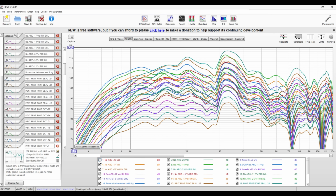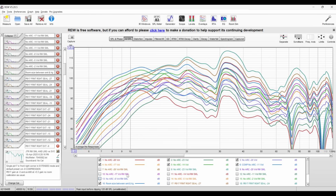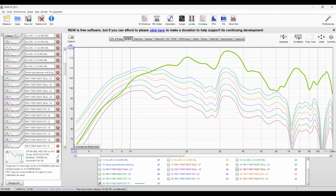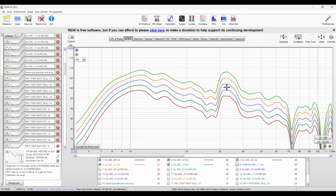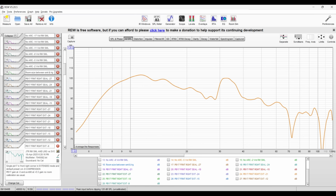Okay, so let's clear the room size set to small first for the JTR, and clear all these other measurements. Sorry guys, it looks a little bit busy, but we'll try and clean this up a bit. Okay, so this is with the room size set to large again, and as we remember, this blue line was definitely compressing. The green line was compressing a little as well. That's right, we were strict on it, so we cleared that one. So the orange line is what we're going to use as our max output with the JTR with room size set to large. So now let's have a look at the PB17 in extended mode.